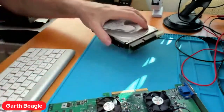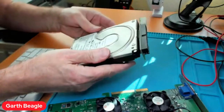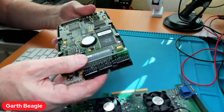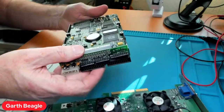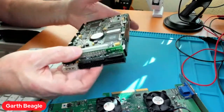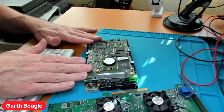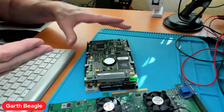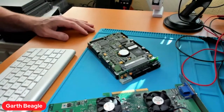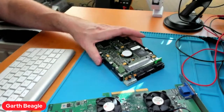It's one of the many SCSI flavors, and this was used primarily on servers. So the top one is called SCA. That's what it is. Oh, SCA. Single connector attachment. That's generic. It's 8.5 gigabytes of pure fast SCSI storage. Yeah, I put that in my Mac clone, and then I didn't set the dip switches right, and it was nested within the system, and it took me like 5 hours to figure that out.